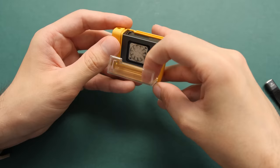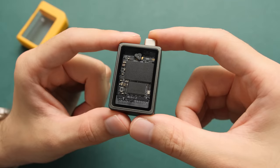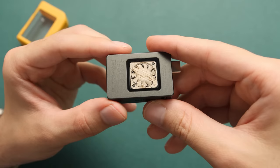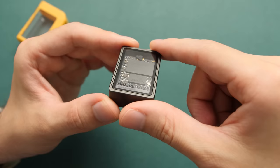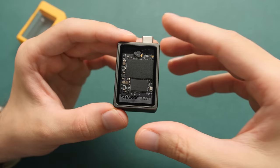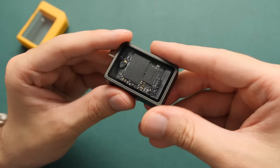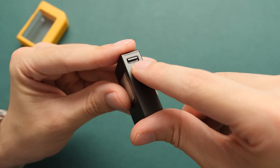We lift up this flap, get it around the corner, and then the entire thing comes free. Now we can get a better look at the drive itself. This is the front side and this is the back. The fan takes in air from this side and then exhausts it out the side as it cools off the main PCB. Enclosures like this aren't anything new — there are USB adapters like this for every size of M.2 drive, but some of them have issues with overheating and this one doesn't. We have the fan exhaust here with a lock switch to put this into read-only mode.